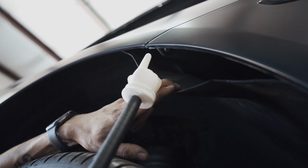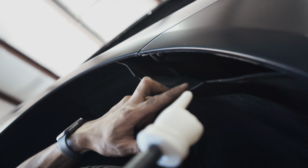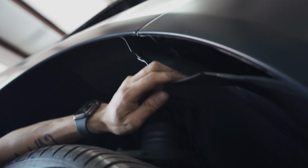You have this one in the corner here, and that's T20, so you're gonna have that on the other side also. And I'm not seeing anything else, so I think that may be it. Just the 4 8mm in the wheel liner, and then the 1 T20 in the corner. This one here is for the camera, and then the one back there is for the light.